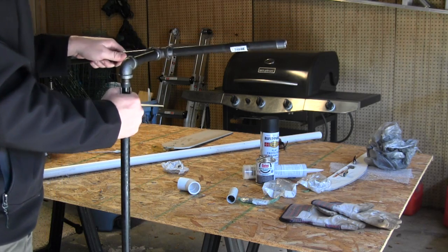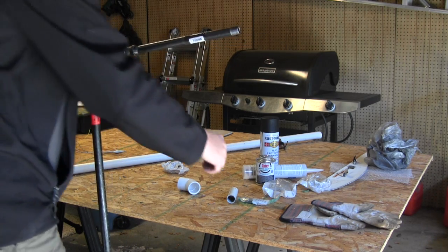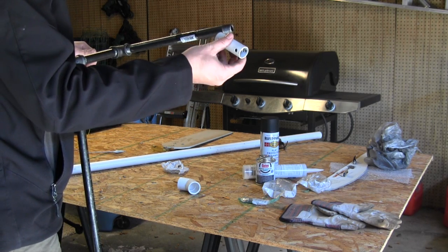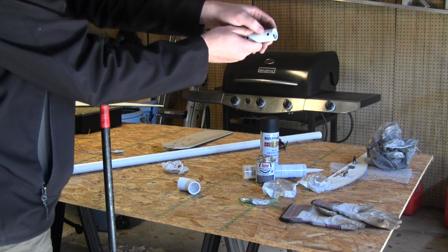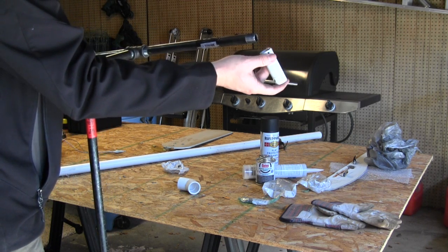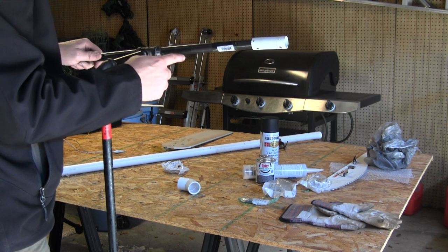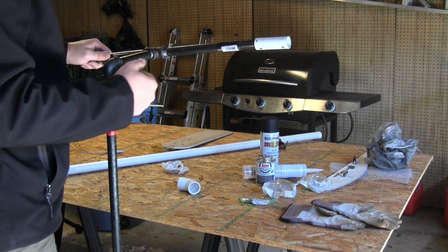What I'm going to do with the wires coming from the fan is run them down in this hole. This is a piece that actually came from the ceiling fan — that's the reason I say keep everything, because this isn't an exact fit into the body of that ceiling fan unit. I'm going to put JB Weld on this as well. It fits into the body of the ceiling fan, and I can put a bolt through that end to secure it. I'll line those up, put JB Weld inside the unit, pop a screw in there to tighten it down — a perfect fit. We're going to run our wires through here, probably closer to down here, and bring them out and zip tie them down.